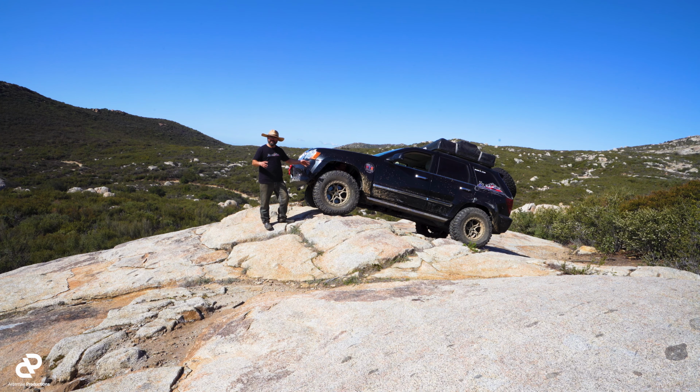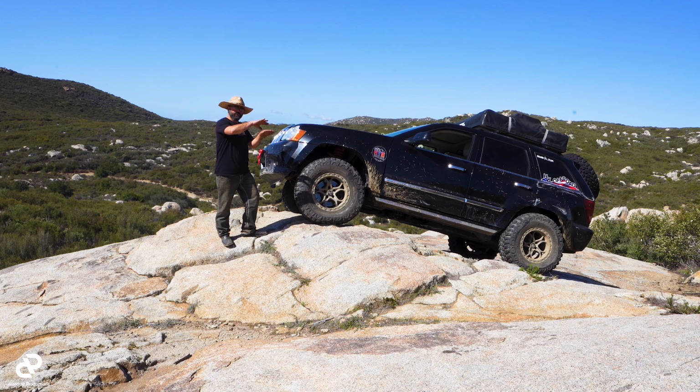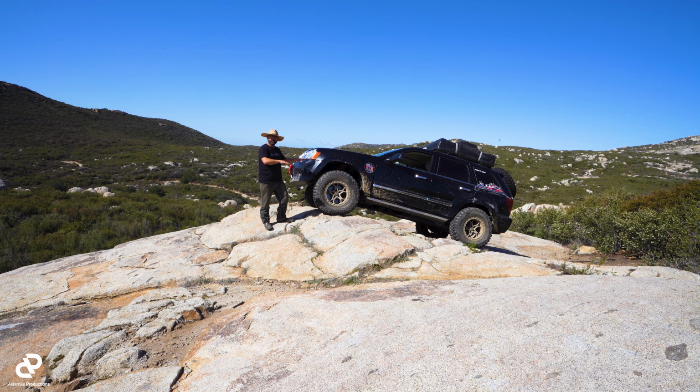This slider, the way it's designed, if you can probably see it in the angle, the slider is angled upwards. So if you compare this to other designs, their sliders are all straight. Unfortunately for the WK, that doesn't work because the WK's rocker panel is angled up like this. It's about a 35 degree angle. So we designed it for the slider to be angled with the rocker panel, so it sits flush with the